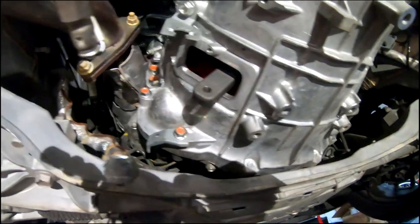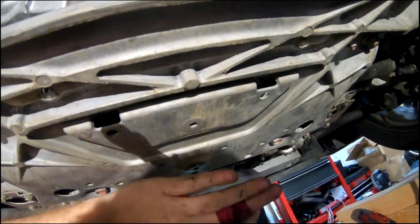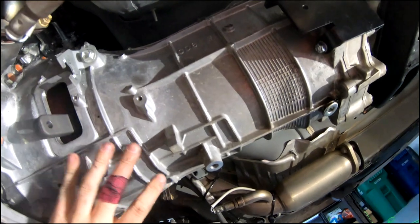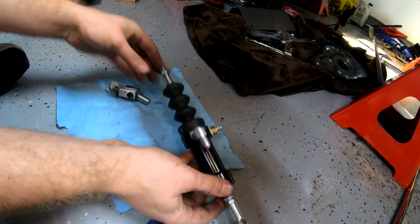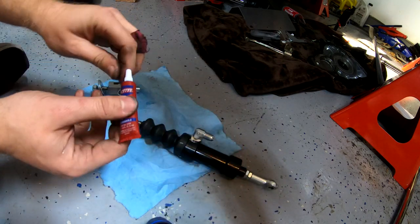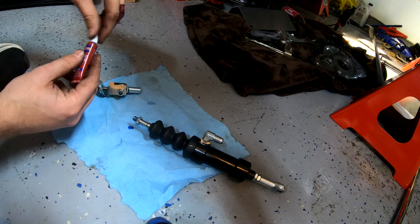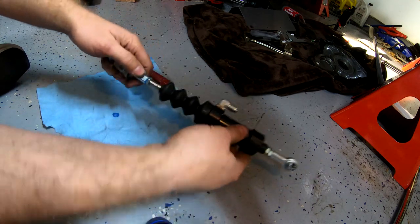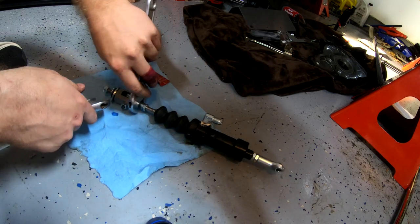I've finished reinstalling all the bolts of the transmission — they're all torqued down now. I've also reinstalled the two bolts for the starter and reinstalled the plate as well as torqued down these bolts at the back holding the transmission up. Now that the transmission is nice and secure we're going to continue working on installing the hardware for the slave cylinder elimination kit. We need to take the new slave cylinder provided with the kit as well as the anchor and thread these together. Before we do that we're going to take a little bit of Loctite, apply some on the thread, and then secure these two together. I'm going to use a couple of adjusting wrenches to tighten them even further just to make sure they won't come loose.